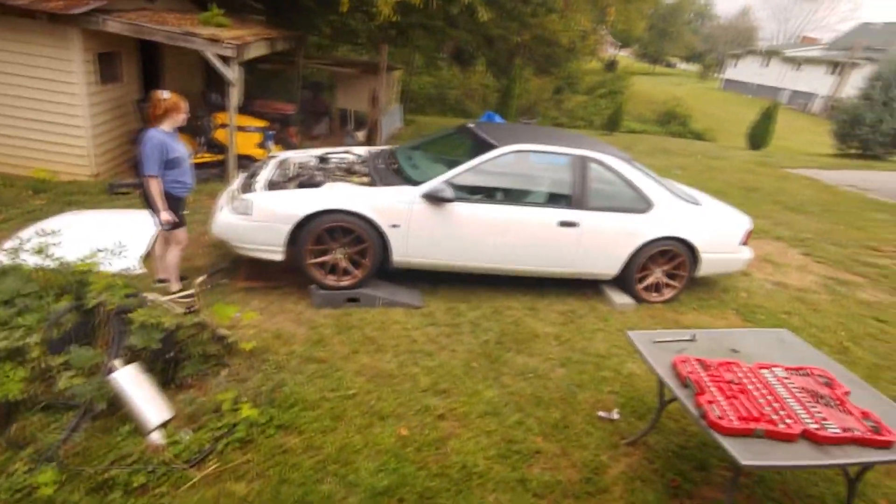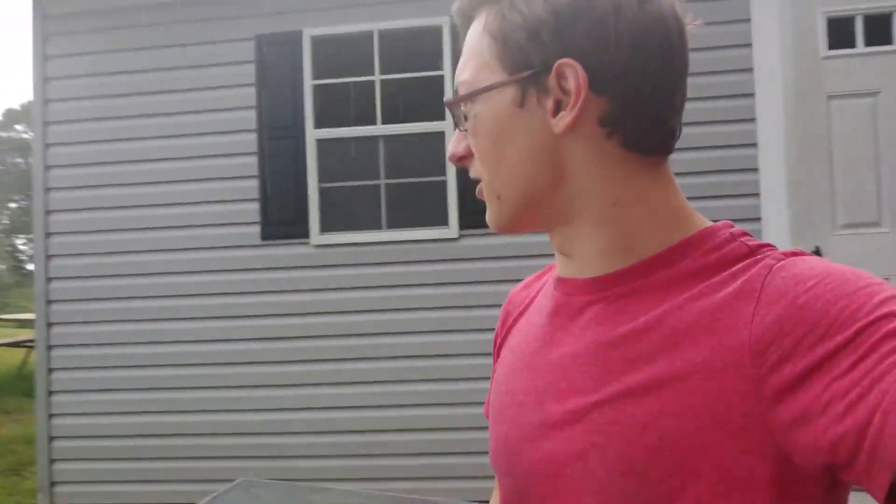Hood's back on — a downpour is beginning. We got pretty far though. The last thing we got off was the throttle body, and I pulled the fuel rails up a little bit. I'm going to have to figure out how to get the wiring harness out so I can get the fuel rails and everything up so the whole intake manifold can come up. That's our first dig into the Thunderbird build, and as it starts pouring rain — see you next time.